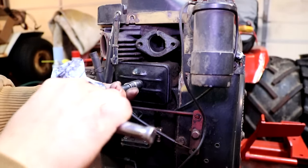To remove the points, it's as easy as removing that point cover — it's just held on with two screws. Then you remove the old points right there, also held on with two screws. Before I install new points, I like to spray a little bit of carb cleaner on the contact points, and then using a material like a dollar bill — or a paper envelope — you just slowly rub the two contact faces of the points with this paper. What this does is remove any protective coating that might be on the points left over from warehouse storage. Just do this a couple of times, and that's all you have to do to get these ready.